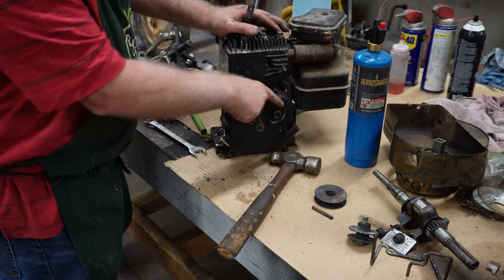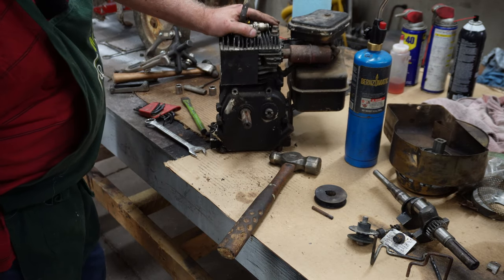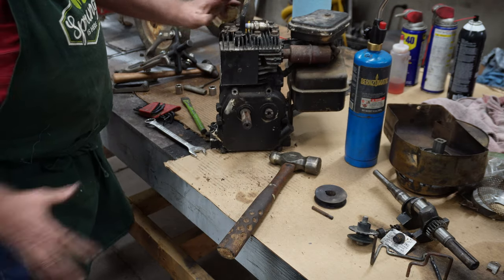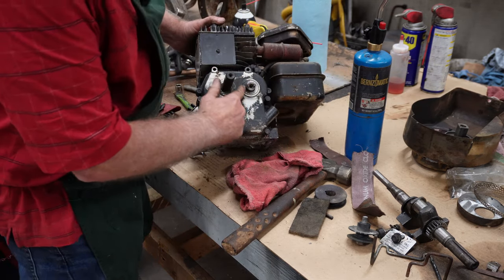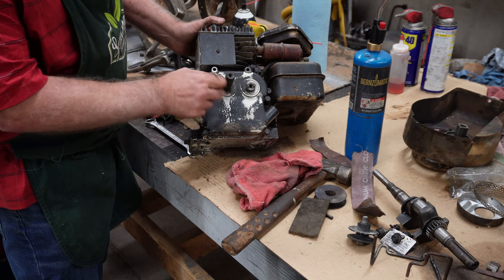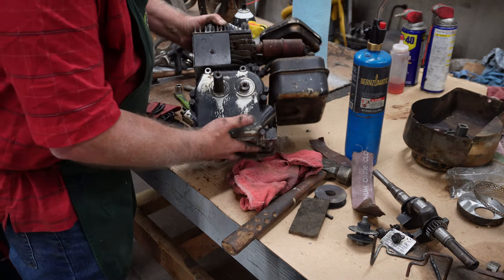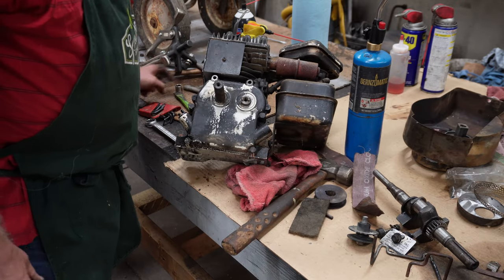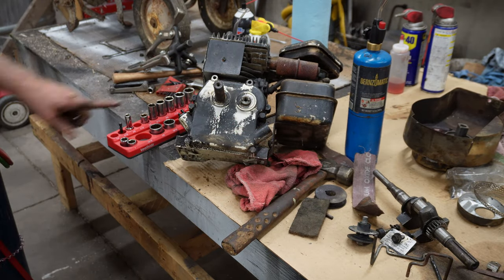I'm going to get something and clean these two shafts here. I need to drain the oil out if there is any, and then we can work on getting that crank out of there. I want to make sure this doesn't fall out of place too, so we don't have to worry about timing. The main reason for wanting to clean this up is simply these seals that are in there — I want to save them. I noticed this shaft is milled down and the seal actually rides on this. The oil in here will stay in the case until I get this off, so let's run these bolts off and take this cover off.